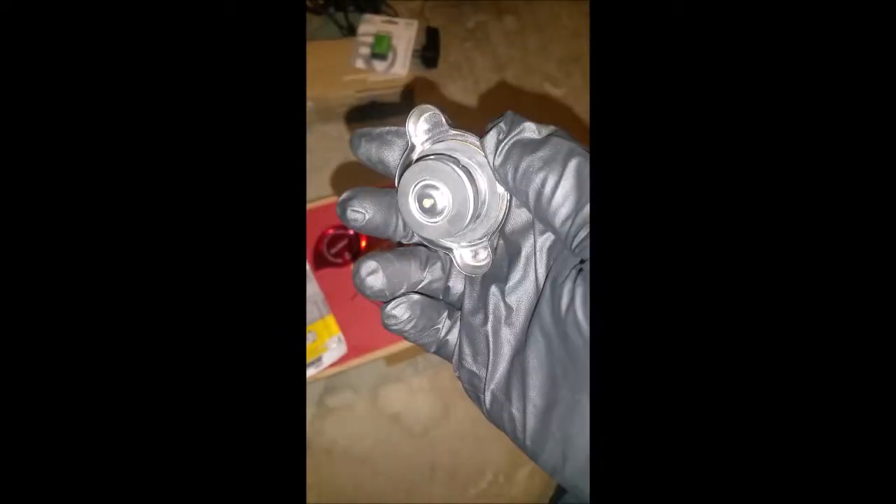What's important is that when you put this cap on, you clean the mating surface really, really well where it screws on. On the 2G DSM, that's the little metal housing on the side of the engine block. Clean that with sandpaper, a scraper tool, whatever you need — just make sure it's really flat.